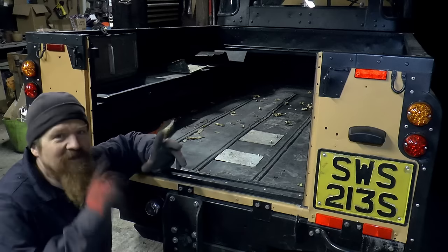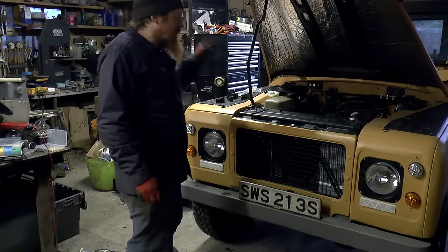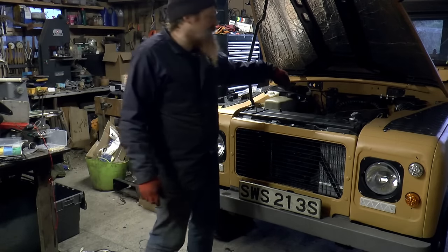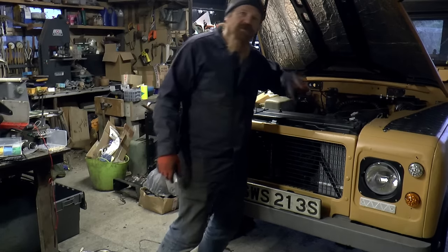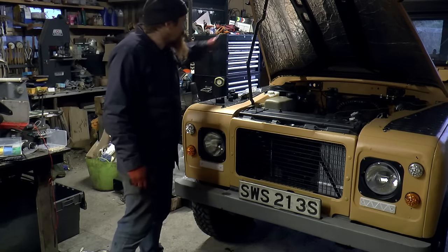And that's that. What I'm going to do now is turn Kermit around and we'll start plumbing in the front lights. Similar procedure to the rear of the truck, then. I'm going to run the earths from the lights to a local point, common them to a local point, and then join those points together and then run them back to the battery. The lives will run straight into the cab.